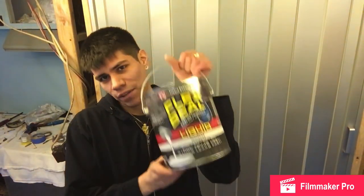Hey everyone, just wanted to show you this project I'm going to be doing today. I bought some Flex Seal because on this whole side of the motorhome there's a lot of little holes about the size of a BB. I think it's from the deterioration of the frame because it's just such an old motorhome, and it's aluminum on the outside. There was a leak in the ceiling for a long time, so probably all that moisture helped with the deterioration. I was going to cover it up — I experimented with it in the back with the leak behind the window and it matches really well with the paint, so that's why I chose the white kind.